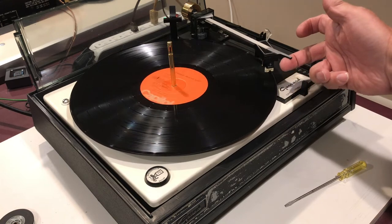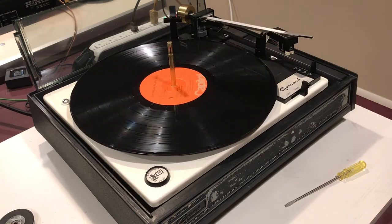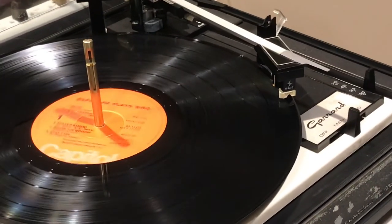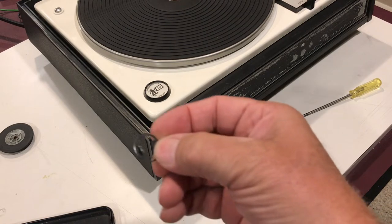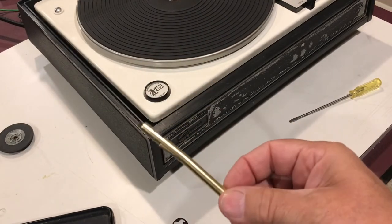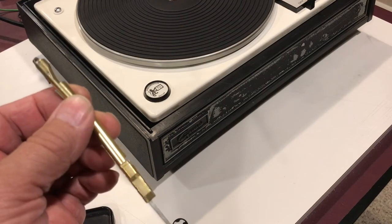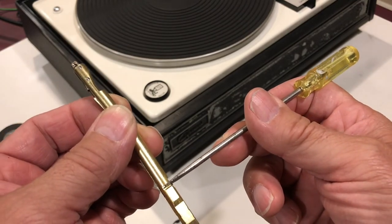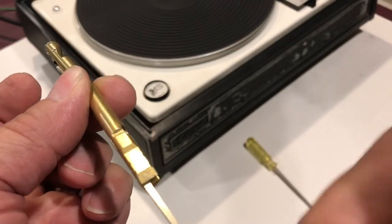All of the other mechanical operations seem to function correctly, but when I inserted the large spindle is when I noticed that this repeat function continued to happen. What I discovered was that you need to have the platter retaining clip in place, installed, and you need to have the large spindle inserted all the way until the second indent holds it in place. You can push it into the first indent, but it needs to go all the way to the upper indent to fully seat the spindle.